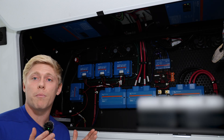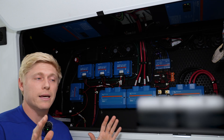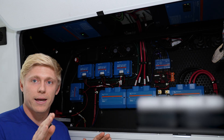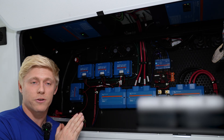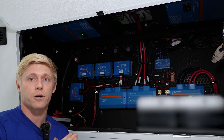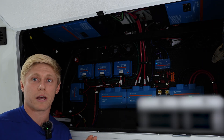However, when we put them in parallel we now have 6000 watts to the entire RV — there's no distinction between leg one and leg two, so it's very easy for these two Multi-Plus inverters to power all three air conditioners, the microwave, and pretty much anything else you want, all at the same time.